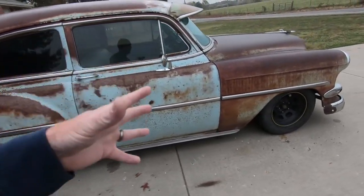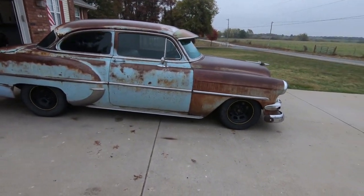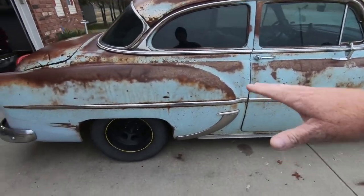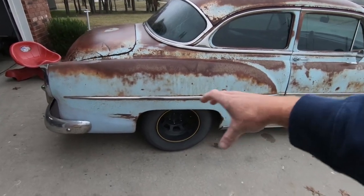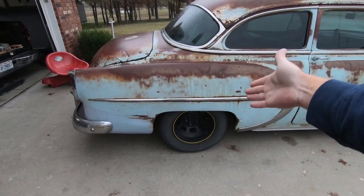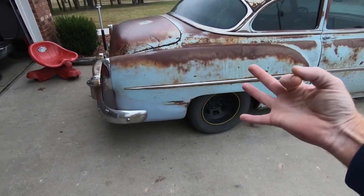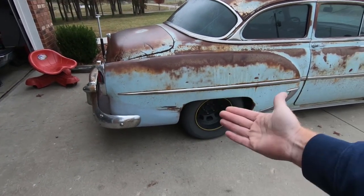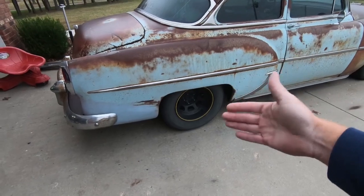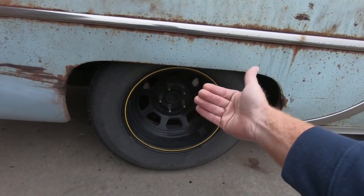When I originally bought this 54, you guys know how I feel about black wheels if you've been on this channel very long — none of the stuff I have has black wheels anymore, so this was going to be no different. I knew I was going to change wheels. When a lot of people build these, they use an S10 rear end because the rear ends in these are kind of like a torque tube, so they're all sealed off. There's not actually a drive shaft that's exposed, so when they upgrade to a different motor like this LS, this 5.3, you have to put a different rear end in because the original rear end will not work. A lot of people source an S10 rear end, and that is what this guy did. The downside is there are three different sizes of S10 rear ends: there's a two-wheel drive, there's a four-wheel drive, and there's a ZR2. The ZR2 is a little too wide, and what is in it is a two-wheel drive, which is a little too narrow. That is pretty much why he put these wheels on here — it's the only thing you could find with this odd offset. You can see they're really pushed in, and we need to bring them out.